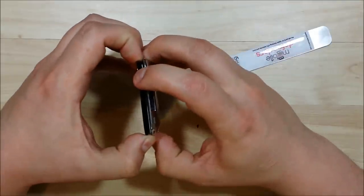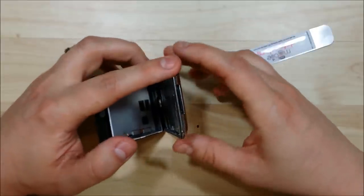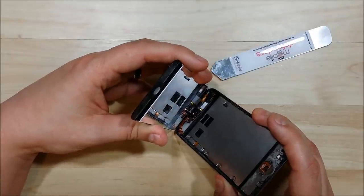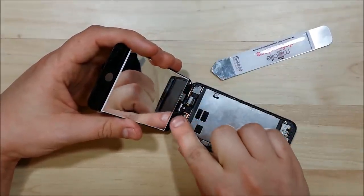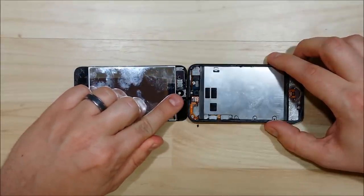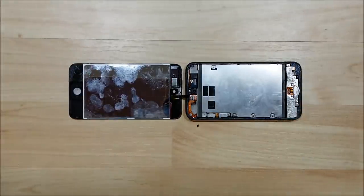The bottom does take a few seconds to pry off — I don't recommend that you hurry, make sure you have a lot of patience as this is one of the trickiest parts. As we separate the LCD from the frame, right here at the top the Wi-Fi connector will usually stick to the screen. There is also a connector at the top for the LCD on the interior. There's a ribbon cable that attaches to the underside of the motherboard which we will not be undoing, so please be careful with that during disassembly.